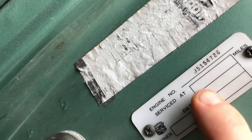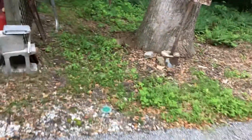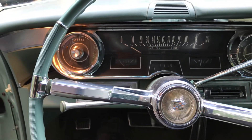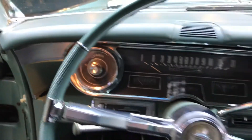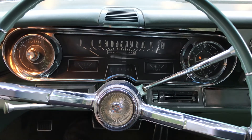I gotta hurry up, it's raining. That is the engine number, which I believe they also used as the VIN on the title. The power seat does not go back and forth — I think it's just a cable problem. There are three cables under there, and the one that has a kink, if repaired, I'm pretty sure the seat will work just fine. When you move the switches you can feel and hear the drive motors clicking, so the switch and the motors are all good — it's just the one kinked cable that won't allow it to function.